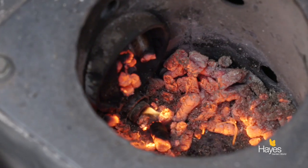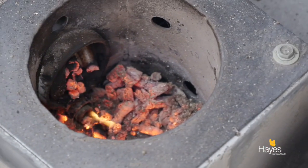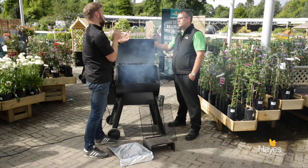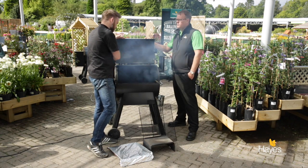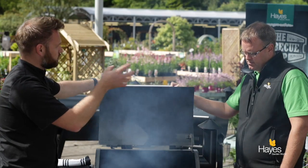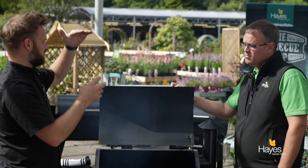If you want to come and have a close-up: down in the very bottom, in the center of the barbecue, we've got this little fire pot. There's a heat element in here, just like the grill at the top of an oven, that's going to glow red. So you've got heat, you've got an air fan blowing in, just fanning the flames - the pellets are dropping into the pot and everything's catching. The onboard computer has a thermostat built into the left-hand side of the chamber, which talks back to the computer. When the internal temperature gets within target range and goes about seven degrees above target temperature, the onboard computer stops calling for pellets and the auger switches off.